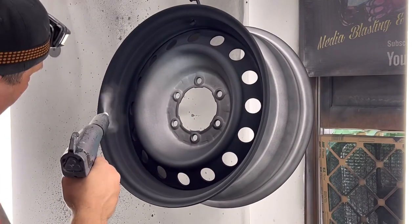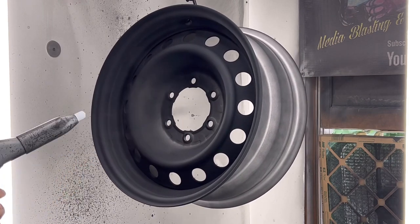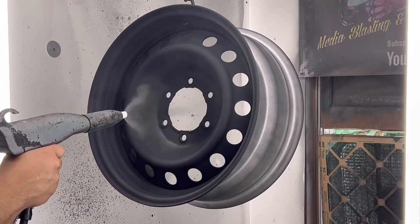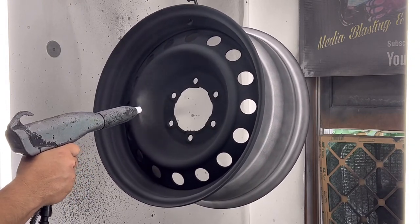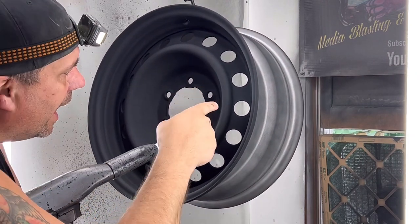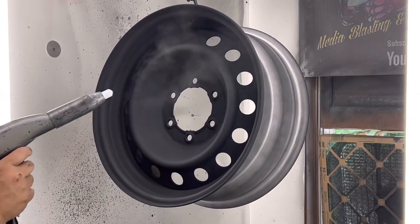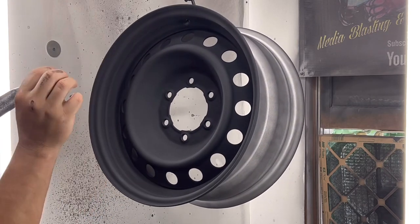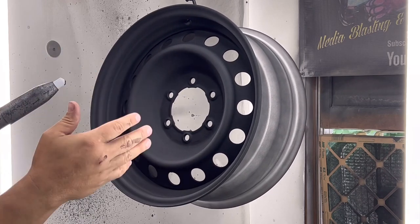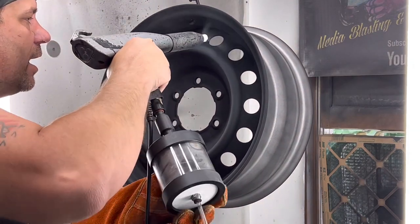So now, since I got my outside, I'm gonna just do my inside, get that taken care of. I'm hearing crackling, which I don't like, so I'm gonna turn down my KV a little bit. But I do not want any kind of crackling because otherwise it was showing my clear and I don't want it to show my clear. Okay, so now I'm looking around the edge. It's kind of building up, but not enough to cover. Because remember, this edge, you're still gonna have right in that crease a white mark. You're gonna get it as best as you can, but if you get this way in there, then you're gonna bubble. And that's the whole reason in hot flocking, so you're not bubbling.